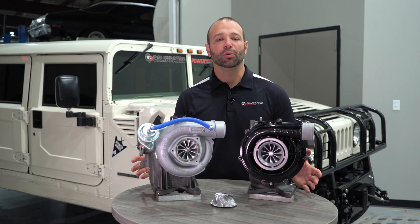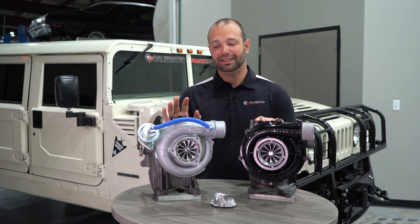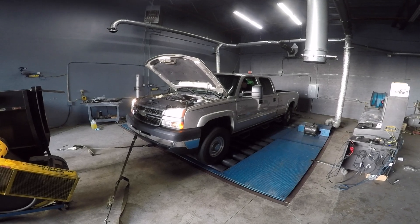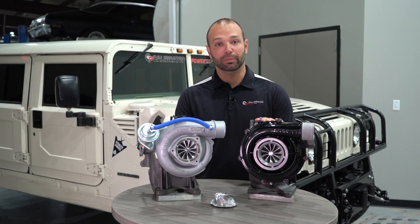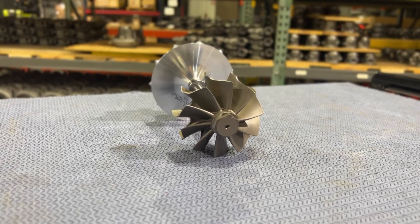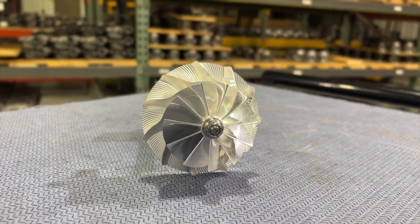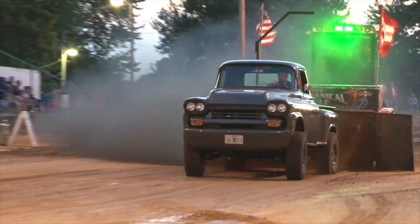I know you're shopping horsepower, you're looking for the one that can support the most. These guys do 700-800 rear wheel horsepower on our dyno. But what you need to look at is reliability and durability. You need turbochargers that have upgraded turbines, that have compressor wheels that aren't going to be prone to surge when you're using the truck like a truck — that's going to beat up the bearings really bad. We've seen that stuff over the years.